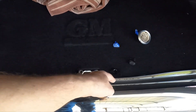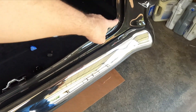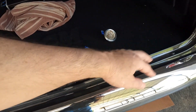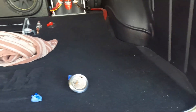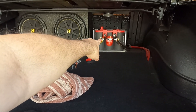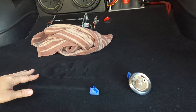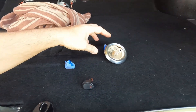I've got that lower channel back here in the trunk floor where the taillight wiring harness goes across, so I can drop the wires off of that and route them over. What I'm going to use is a little inline fuse — I'll hook it onto my battery cable with the fuse really close to the lug, then run a direct hot wire to it. So if it ever shorts out, it'll pop that fuse and have its own fuse system.